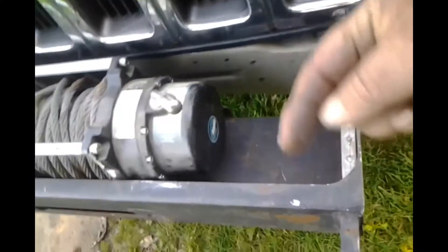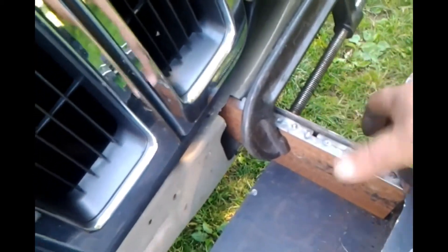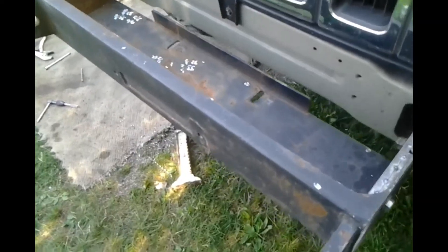That's heavy. As you can see, we are literally up against — if you're wondering, that's the loop, it's spun around. We can however come forward a little bit if we need. Okay, we're going to dial a quarter of an inch more — that gives us a little extra here. All the measurements from the unit body — alright. I step back, we look pretty level. I'm going to drill and tap some holes for a couple bolts on each side, so right now I'll be able to remove this if I had to.